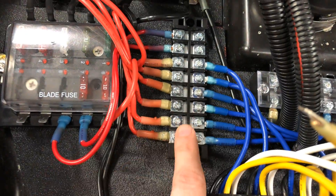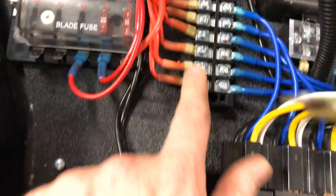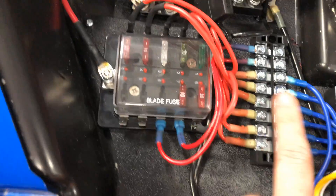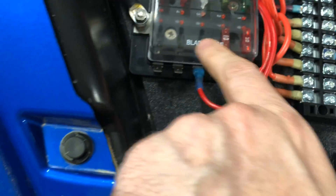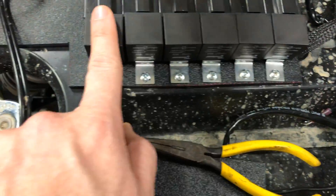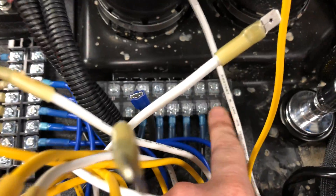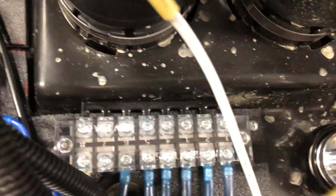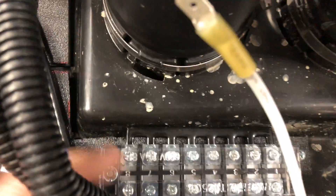All of the power inbound to the relays have a block over here, which is basically just a junction between the relay and the fuse block. So fuse block here — this is a 10-place fuse block. All of the numbering lines up, so this is 1 through 6, and these are junctioned together, and then my ground actually comes in on number 8 over here.